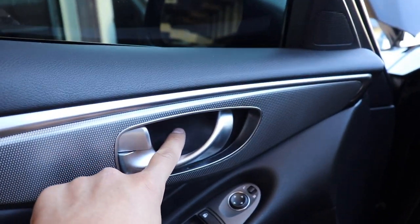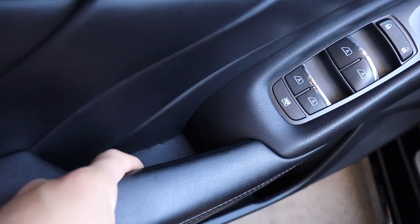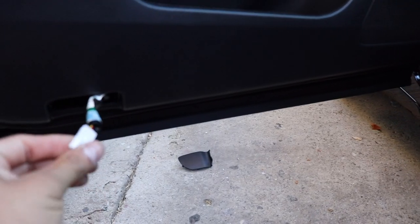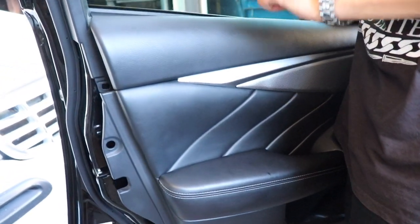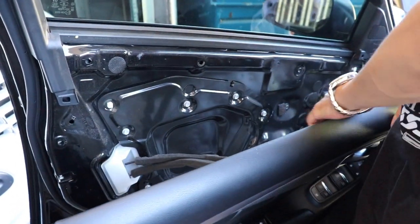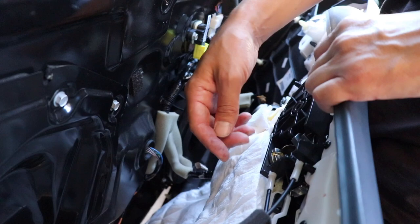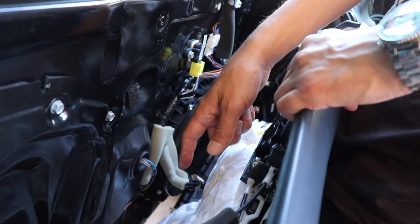To remove your door panel, there's a cap right here — remove it and get the bolt behind it. There's another one here, same thing. There's one down here as well. This is your puddle lamp. Once all the clips have been popped, the door actually comes off pretty simply, but that's not always the case. Always keep a good grip because you're gonna encounter a few clips, and you don't want to end up paying a professional for a DIY job.